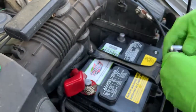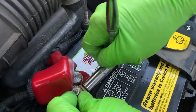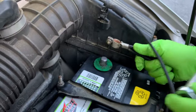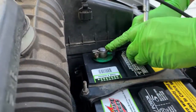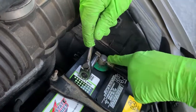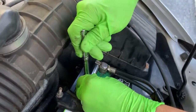Okay, now we are going to do what we already began at the beginning, which is tightening your terminals. You got the first one really nice and tightened — do not over-tighten, remember that. Now we are going to position the negative, and I already have the grease on it, my ends are very nice and clean, and I will be putting my second terminal on. I'll tighten it just as well. These tools are so nice for that because you can keep a clearance between your ends and yourself — with other tools you can do it, but not as nice and easy as with these particular tools.